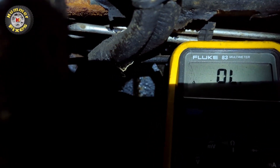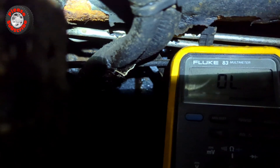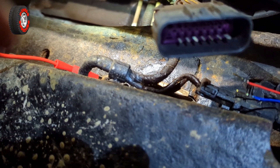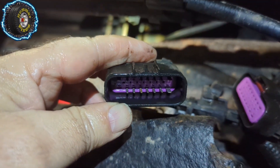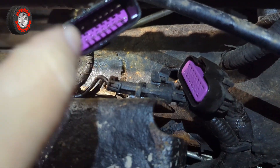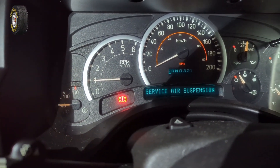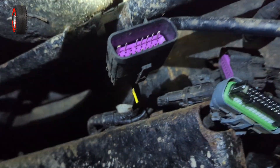It's a bit theoretical at the moment, so I'm going to clean that pin up using a fiberglass brush to scrape the oxidization off, then spray it with contact cleaner and put the connector back together. I'm going to do both sides of the connector very gently, just cleaning off the corrosion. As you can see I've cleaned the connector quite well - the only problem is I can't reach the internal pins. After spraying with contact cleaner and reassembling, despite the corrosion, the connector appears to have been making contact, but we've still got the 'Service Air Suspension' warning.